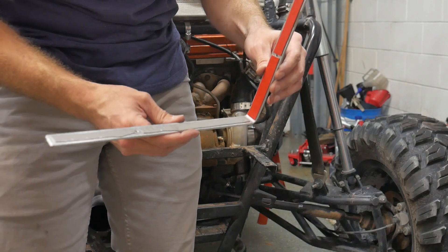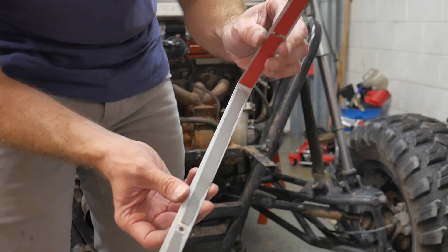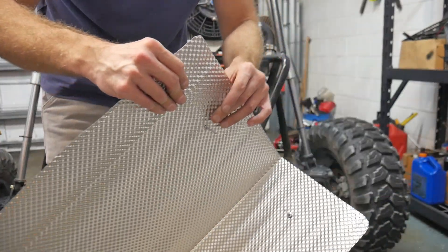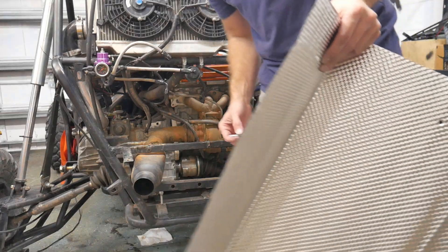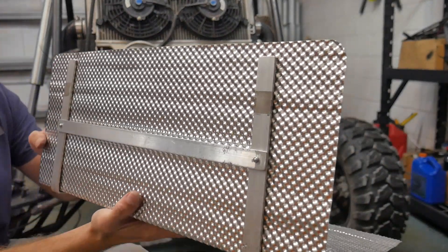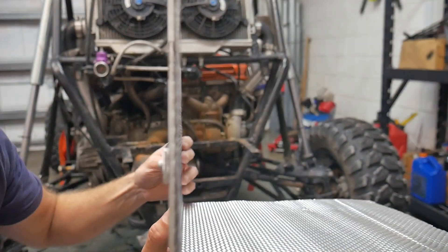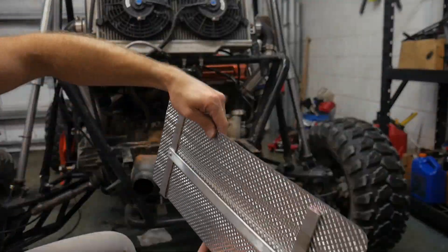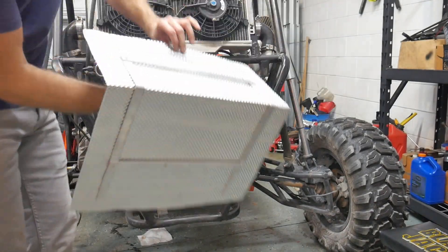Before I get my frame fully assembled, I just want to show you: I've put one hole in the frame here and one there — that's going to get riveted. This is just double-sided tape; I wasn't sure if it would have a good stick, but it sure does. I'm going to get this riveted up and then we'll get it installed. For a bit more peace of mind, I added a back frame around here. We're all riveted together, with a thin piece of double-sided sticky tape wherever the frame mounts to the actual heat shield. It looks pretty good — it wasn't sturdy before, but this frame made a big difference.